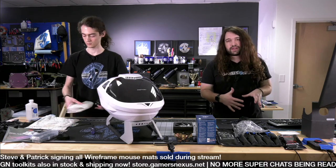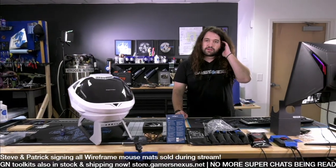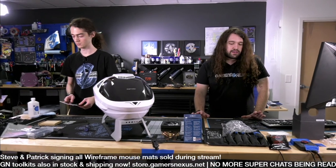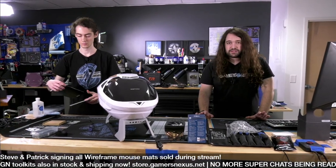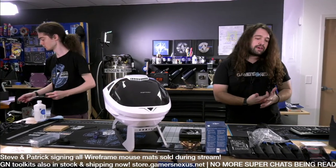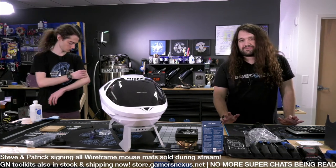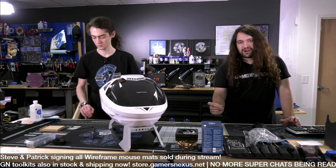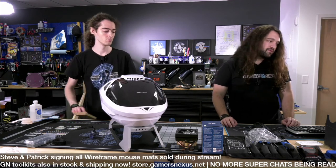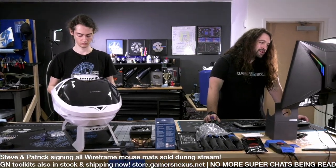It's like the Cooler Master stuff, and anyone who buys from Cooler Master, so other brands might use them as a supplier. So if you have the plastic corrugated tubing, do not stretch it, because if that Teflon cracks, permeation gets a lot worse. For the rubber tubing, it can stretch a little bit, but if it's stretching on the barbs, then there's a problem, so try to avoid it. A little tiny bit of stretch is maybe doable on the rubber ones, but I would try to avoid it.